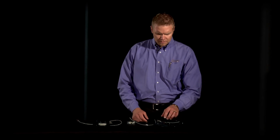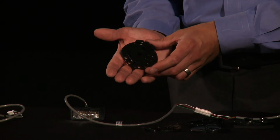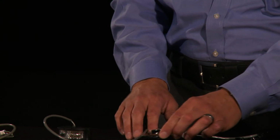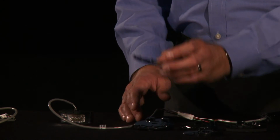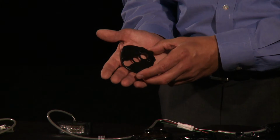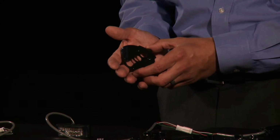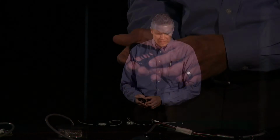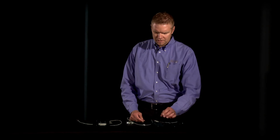Included with the original Intersector light, there's a series of different wedges. 0, 5 degree, 10 degree wedge, just in case you need to adjust the level of the light output. And also we have specific and custom brackets that'll work on any vehicle, whether you have a Crown Victoria, the new Police Interceptor, Chevrolet Caprice, any of the patrol package vehicles, we have wedges for those, and they can be ordered separately for ease of installation.